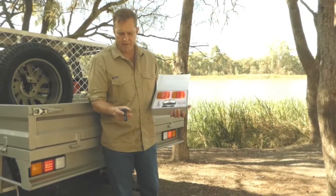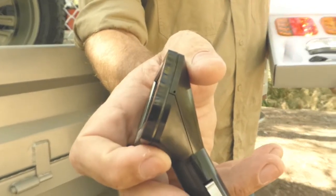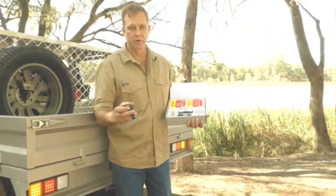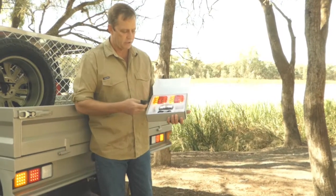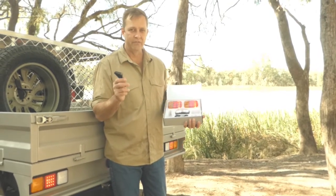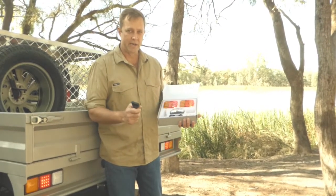When you order a new one, you simply grab your in-vehicle monitoring system. There's a small hole on the side that you press in and you move through the sequences. It tells you what to do as you go through on the LCD screen. It will then look for five components — two of these, one of these, the trailer connector module, and this — no less or no more. When it finds those unique five, it will lock down the new set. So you've introduced your new replacement unit, it locks down the new set, and you're ready to go again.